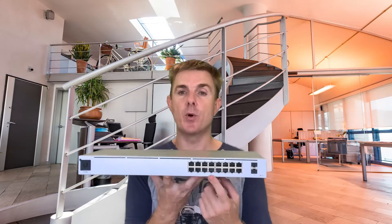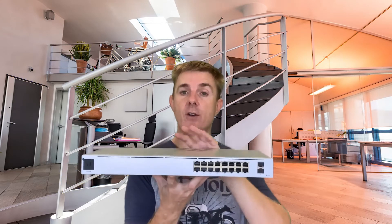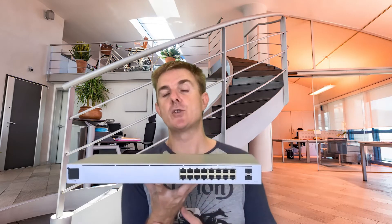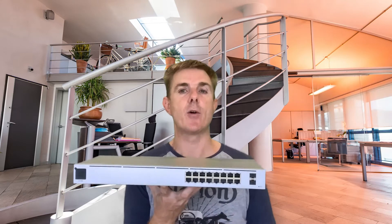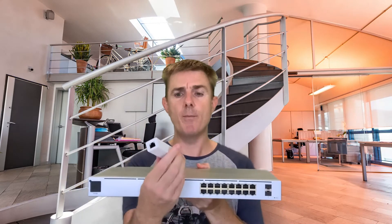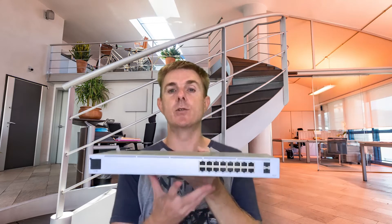This USW-16 has eight ports of PoE. Traditionally with Ubiquiti switches you'd have been used to all ports being PoE enabled unless you bought the original US-8 60 watt. This unit only has 60 watts of total power and only eight PoE ports. Importantly, these are PoE Plus ports only — you no longer have the option to switch a port to 24 volt passive. So if you have any legacy cameras, access points, or AirMax equipment, this switch won't power them. I recommend keeping some Ubiquiti instant converters on hand — the 100 meg model takes 48 volts in and outputs 24 volt passive, so you can still power legacy devices when upgrading a network.